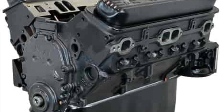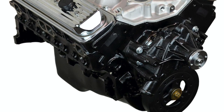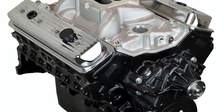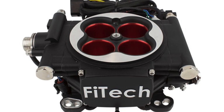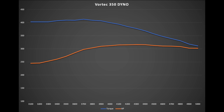It's basically just a stock 350 Vortec, upgraded just a little bit. On the dyno it was run with a 600 Holley carburetor, but when I installed it in the car it had a 600 horsepower Vortec fuel injection kit put on it. It had different headers than what were run in the car — mid-length in the car and I'm pretty sure long tubes on the dyno, like an inch and five-eighths long tube headers.